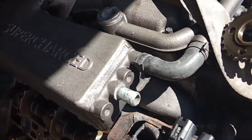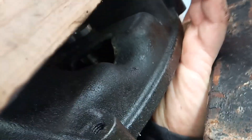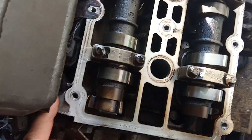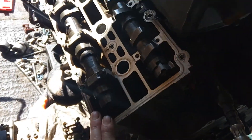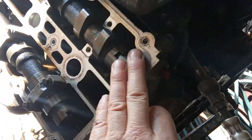Then one fits right at the back of the engine in here, which goes into the back of the sump — you can actually see it there, it goes into the flywheel. Now, the problem is this AJ27 has got two camshaft position sensors — one on this side and one on this side.